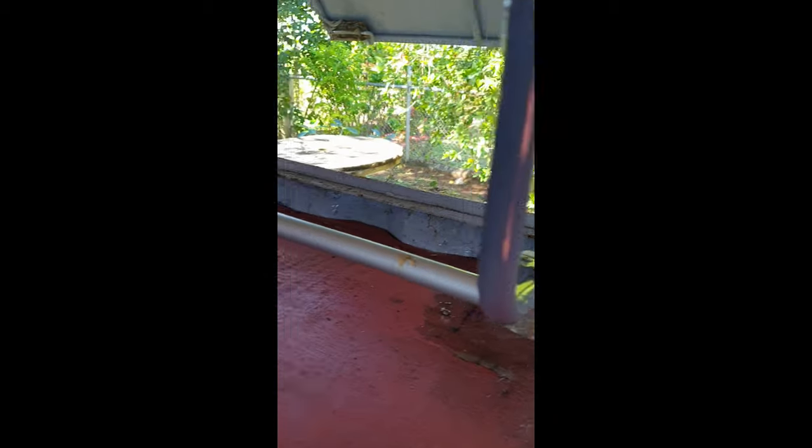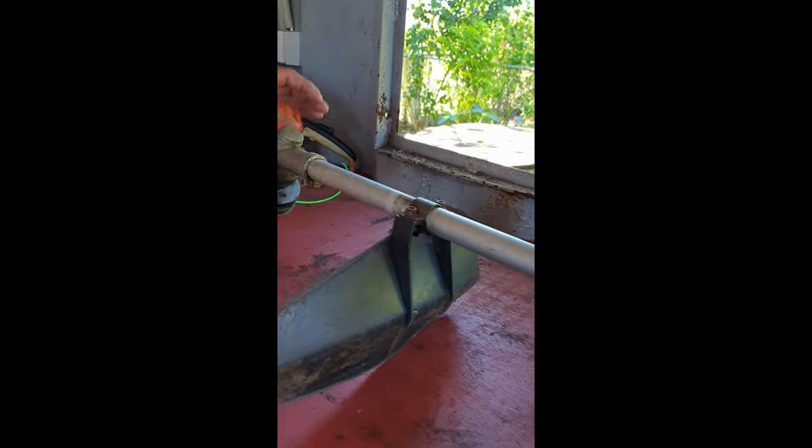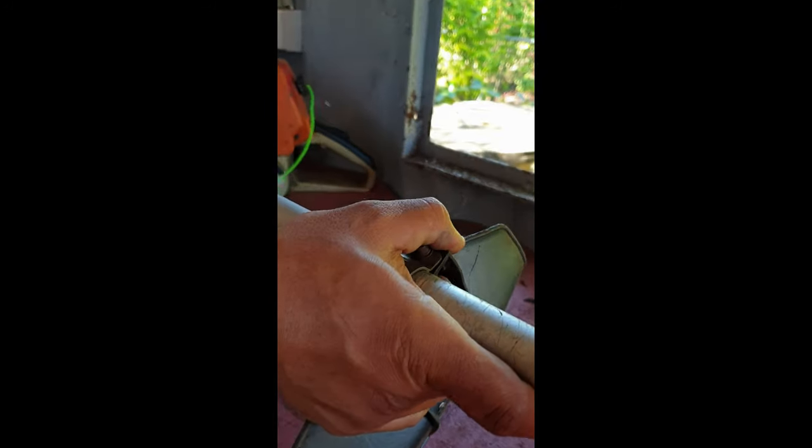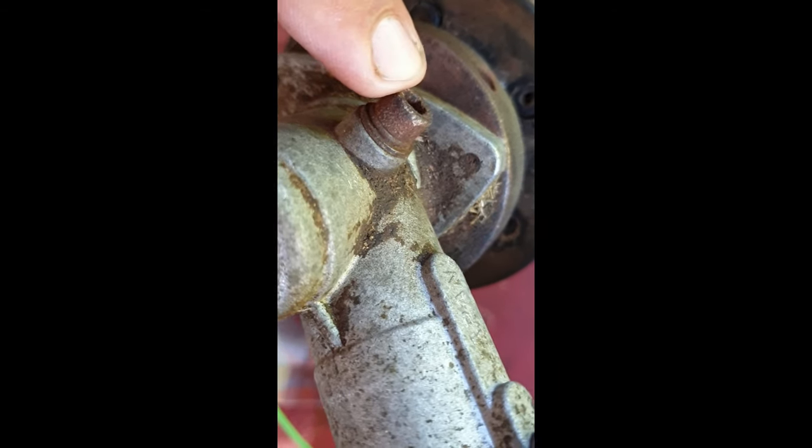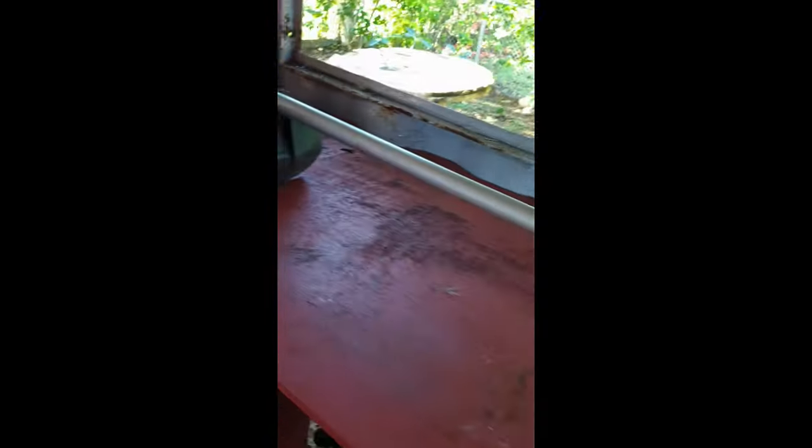And if you come right down to the bottom where the spool is, there's a gearbox as well. So when you have them serviced with us, we top up the oil in this gearbox, or we top them up with grease. Either one works well. We usually use oil, which in actual fact is better for the gears.